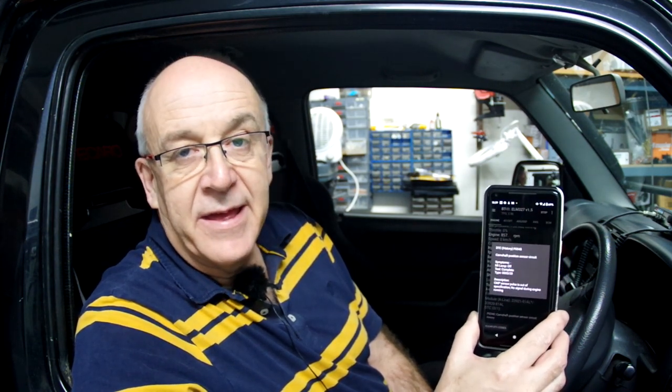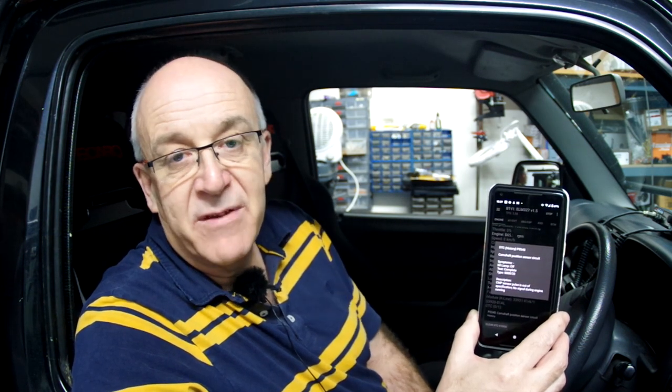Okay, so here we appear to have a symptom where the car doesn't start well when it's hot. Strong smell of fuel, that's because it's not firing, but fuel is still coming through the system. And we have stored a crank position sensor failure in the history. So what I'll do is make sure I've got a new sensor on order from the Big Jimny store, and I will also keep an eye on this for the future. What else can we see while we've got it on?